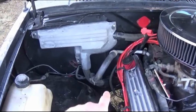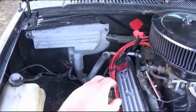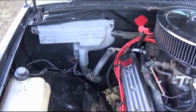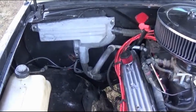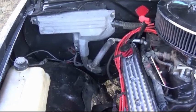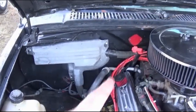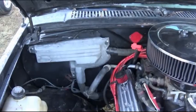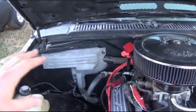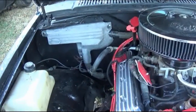Alright, now I used the existing hole down there for the wiring harness. I have used some trim over the edges to protect the wiring. I made a little panel to block off the rest of the hole instead of using foam like the previous owner. So I got a little touch up on paint down there, a little touch up right there. But now I was trying to go with a kind of factory look on the wiring, and I think that kind of gets it there.